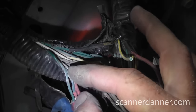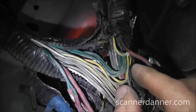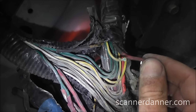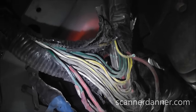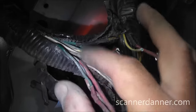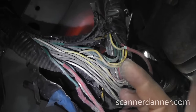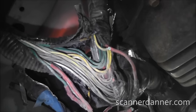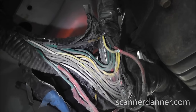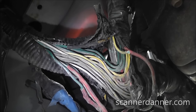Fortunately, I just need to tell this garage what to do — I get paid for diagnosing it. We'll do a wiring repair, clear the codes, and everything is going to be great. So the transmission limp home problem was caused by a corroded wire — actually multiple corroded wires — but one main one that was preventing the relay from being turned on.